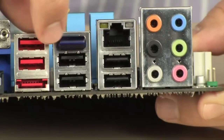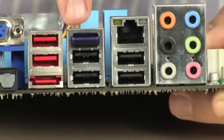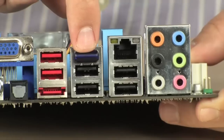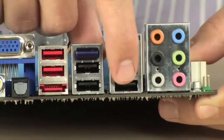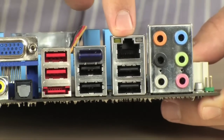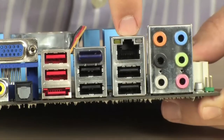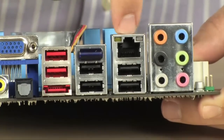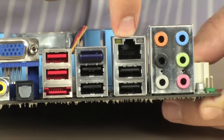This is really cool — this is actually a Bluetooth receiver. So if you want to hook up a remote control, media center remote control, or one of those little portable keyboards and mice combos, you can. Because again, this is the perfect home theater PC motherboard. Four more USB 2.0 ports, and very important: 10/100/1000, or gigabit ethernet, because this is probably not going to be hosting all your video files. You're going to stream them from your server or desktop PC, so you're going to need that gigabit ethernet to transfer the very large high-def files.